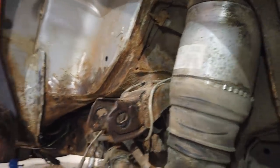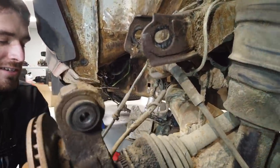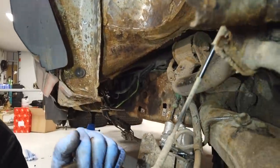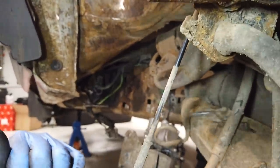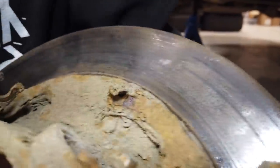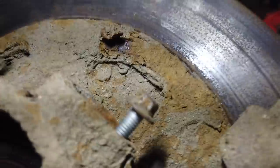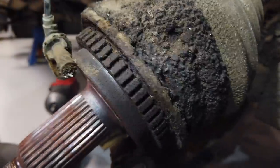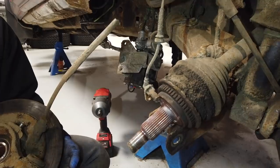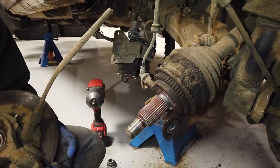It's still not having it - let me use a screwdriver. It's coming - just rest it on the bottom. Right, now we've still got the ABS connector. We forgot - the handbrake cable's already cut off, but we need to disconnect the ABS sensor. It's got a little bolt holding it on the side. You have to wiggle it out of the housing because it picks up on this little ring here - that tells the ABS system whether your wheels are turning or stopped. There we go - there's the hub. Not a textbook demonstration, but a real-life look at how to take your rear hub off your Land Rover Discovery 3, Discovery 4, or Range Rover Sport. Hope that helps someone out.